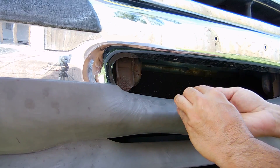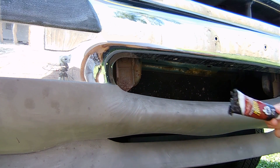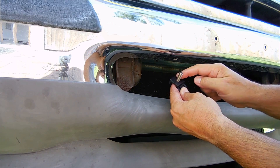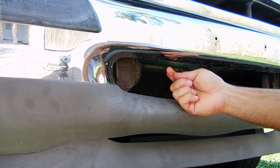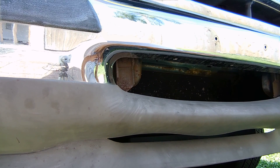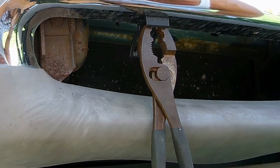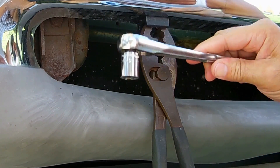To make sure the bumper doesn't rust where I drilled the hole, I'm going to take some black silicone gasket maker and apply it all around this side of the bracket. I'm going to push this up against the bumper, apply more on the opposite side, and then install the washer, lock nut, and nut. On this side you're going to hold it with a pair of pliers, because there's really not enough room to get a socket in there. On the opposite side, take your ratchet and tighten it down.